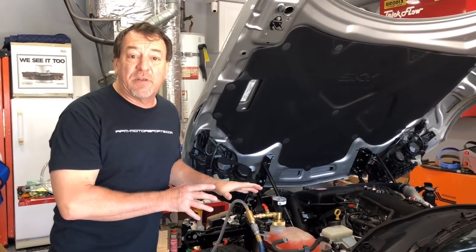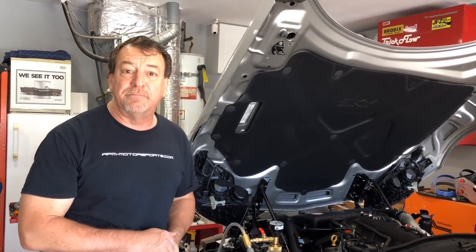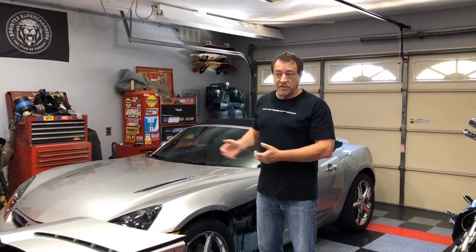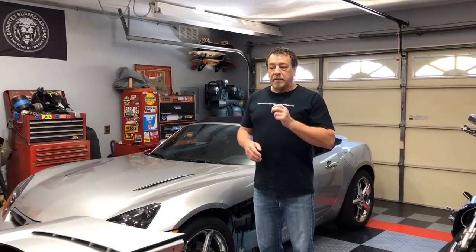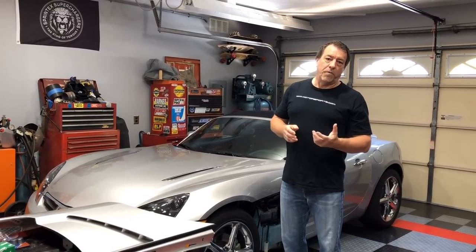I'm going to shut everything off, button up, drive it for a couple of hours, then redo the process after getting the transmission fluid topped up. The cooling system is now purged as completely as possible. My understanding is you need a couple of drive cycles to pull all the final amounts of air out. The way you do that is run the vehicle, let it cool overnight, and recheck the reservoir level. If the level has dropped below the seam, top it up in the morning when cool. Never open the cooling system hot or even warm, as the contraction of air when you open it may draw more air back into the upper portions of the engine.